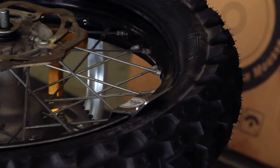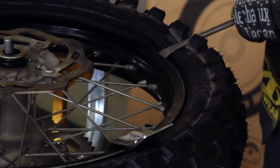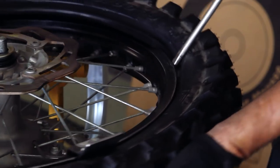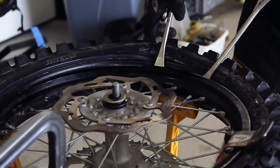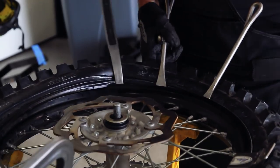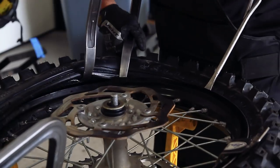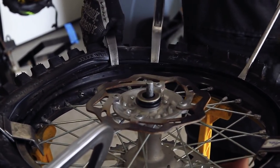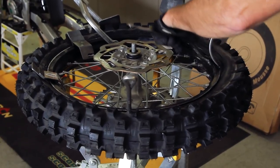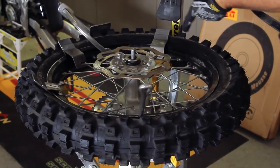This part here is down in the dish. As I flip this over, I'll use my tire iron upside down — turned over from putting it on — as one more tool to force that tire down inside the dish of the rim. Now I'm going to switch to my angled irons. The angled iron is really nice because it goes right in and gives you the leverage to slide that up and over. Without the angle on the iron, you're more prone to scratch your rims and it's harder to get in. When I get to this point, I want to make sure the bead is down in the seat. It's hard to get another tire iron in there, but just let this side off, put the tire iron in, flip it back over, and you've got it. At this point I usually just give it a good smack with my hand and it'll go right together.